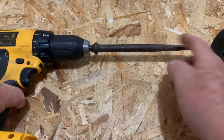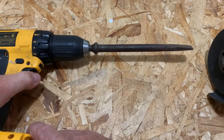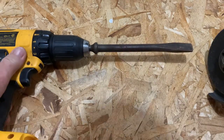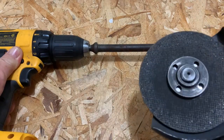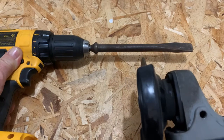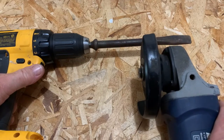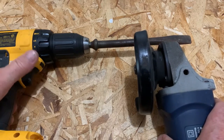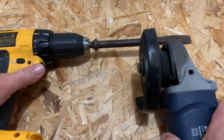To get started, just chuck your old tool up into a drill. It's nice to have a helper to hold your drill steady, and then put it in the vise. As you can see, it turns nice and uniform. The next thing is to take an angle grinder — as you can see it's got the thin cutoff disc on it. I like resting it on the guard there. All you do is turn the drill on, get it spinning, and then with the grinder just slowly feed it in there.